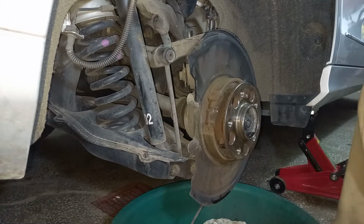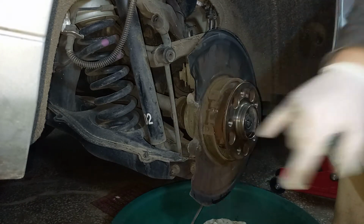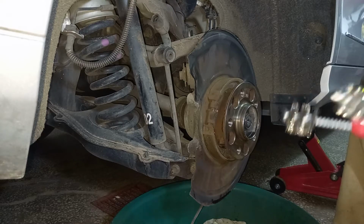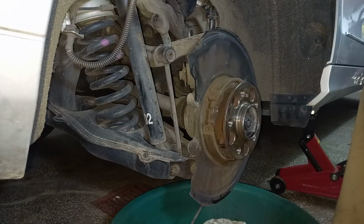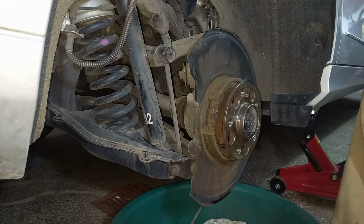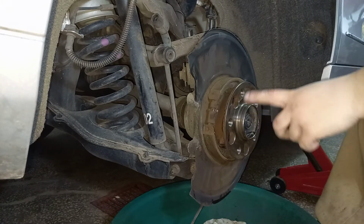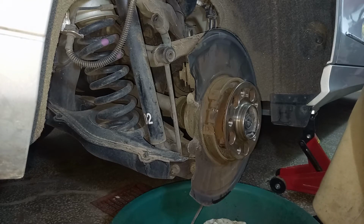Okay, I've had a 2 or 3 hour setback. The brake caliper carrier, all the bolts and the holes for the carrier themselves were a mess due to the thread locker. I've managed to clean them. I've bought a couple of metal brushes, 15mm and 22mm. I've knackered 3 of these just to clean the holes very well, and now it's time to put everything back where it belongs. Also, I wire brushed the entire flange because it was full of rust and stuff.